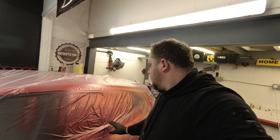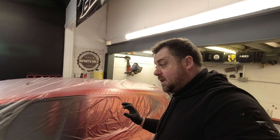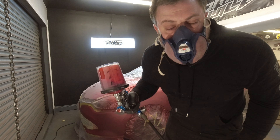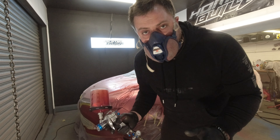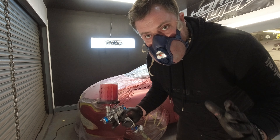I've been told two or three coats of this pearl should do it. I've sprayed a base coat on the window here to test the pearls on first, just to see if I'm getting a close match, and then I'm going to blend them down on the wing and take this very, very slowly. I've got my gun dialed in, just tested it on the window, air pressure checked, PPS cup on — let's get it done and hopefully get it right this time.